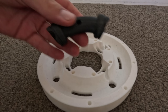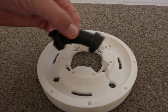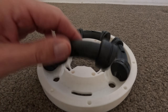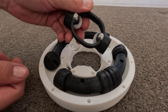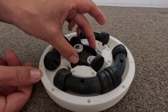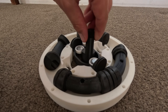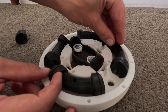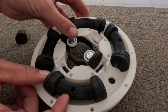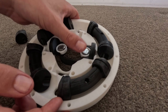First up we have the housing, then the four pistons that are shaped like this — they've got a hole through the middle which connects the drive, and a little cutout for the spark plug. Then we have our valve piston which sits in there, and that works on this small cam. This is actually stationary. So when we're drawing in the mixture, this will be this way, which exposes that port, and as it rolls around this valve shuts.